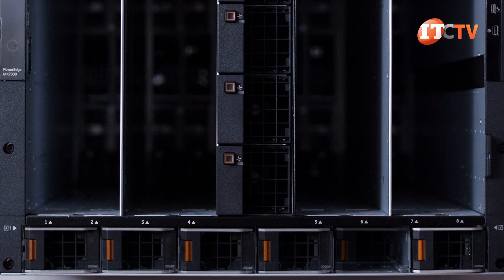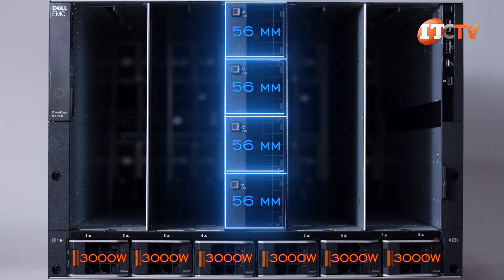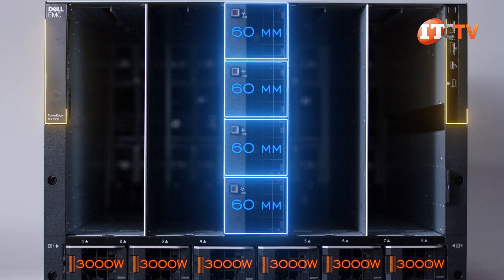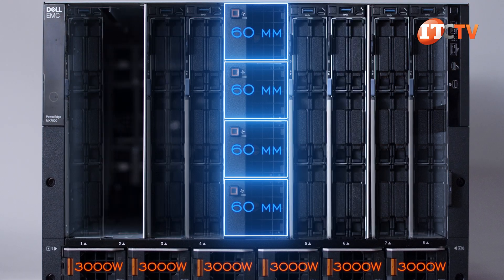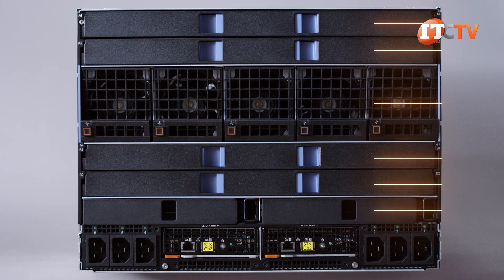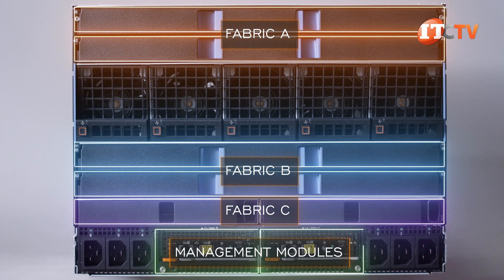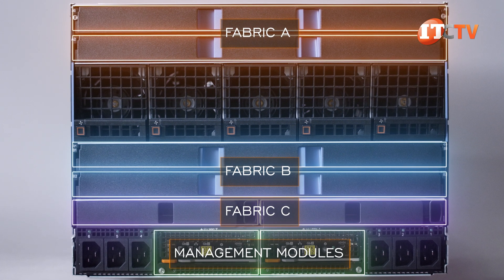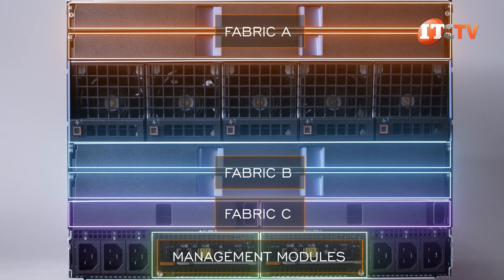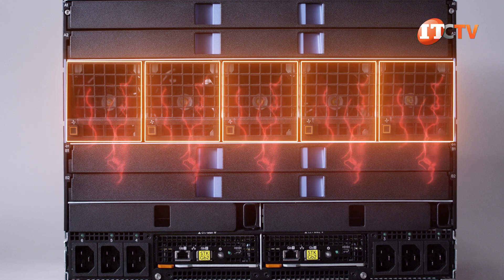There are six hot-swappable platinum-rated 3,000-watt PSUs located in the lower front portion of the chassis. Above those, four 60-millimeter fans arranged vertically right down the center, with control panels to either side. With compute and storage sleds on the front arranged vertically and modules in back arranged horizontally, each blade can connect to I/O fabrics A and B, plus the storage C fabric and management modules. There is the potential to install two of each of the modules for redundancy, but it's not required. There are also five more fans in back pulling that DRAM and PMEM-scented air out of the chassis.